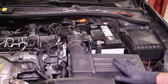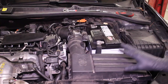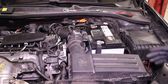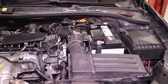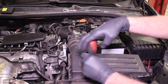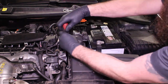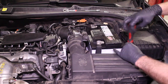We got the engine cover off. I'm going to go ahead and remove the airbox as well. Start by removing the top cover of the air duct and lay that to the side. Now I'm going to take the entire airbox cover off — you do need to remove the lower portion in order to get the battery tray out. We can leave the airbox as one unit or separate it into two pieces, or leave the top in the vehicle and only remove the bottom. I'm going to start by separating the two pieces. This older sport wagon has Phillips head screws, while other models use T25 Torx. This is also a good opportunity to inspect the air filter for your customer.